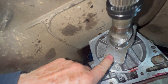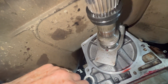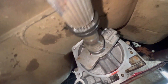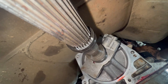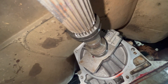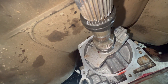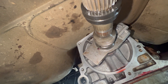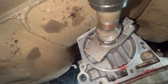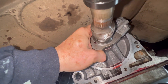These governors on the Ford are like the modulator valve on a GM, like a Turbo 350, Turbo 400, whatever. And that's why if this thing isn't letting fluid go through the right passages, it's not going to shift. That's why it'll go into first, it'll go into reverse and move with no problem. But like a GM, if you had the vacuum line off the modulator valve, it's going to go to 6,000 RPM and it ain't going to shift. So that's what this does.